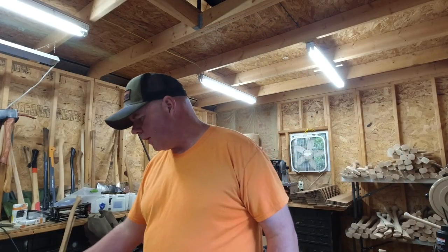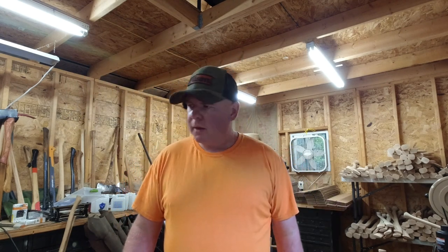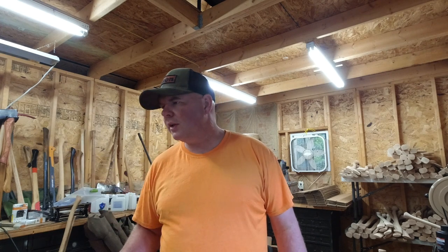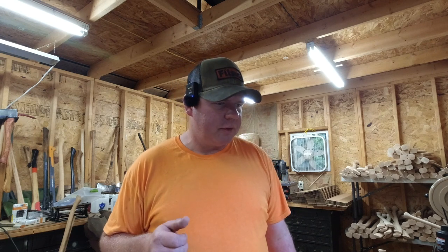That's my three primary chainsaws, all cleaned up, ready to go. I do have to sharpen two of the blades, so what I'm going to go ahead and do is finish cleaning up the rest of these, and then I'll sharpen the blades later. But I think I'm going to wrap this video up because it's going to be stupid long, but you guys get the idea. Blow them off, wipe them down, check over everything, blow out your air filters, and fuel them up with some fresh gas.